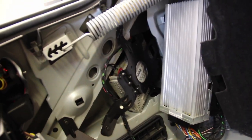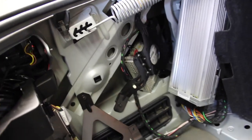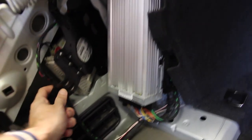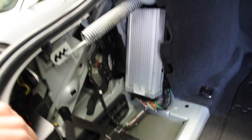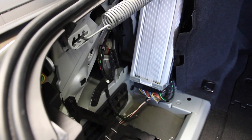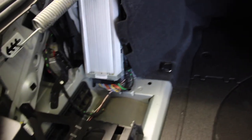The module is two-thirds in — the pre-wiring harness has a little white peg that fits into a hole and provides nice cable management. I verified with another E60 M5 owner that it installs with the white part sticking out, pressing in from the back. The third mounting point is behind the amp — you're probably going to drop the bolt about ten times. The BMW instructions say to pull the amp out. I tried for about two minutes without pulling it, then lost patience.